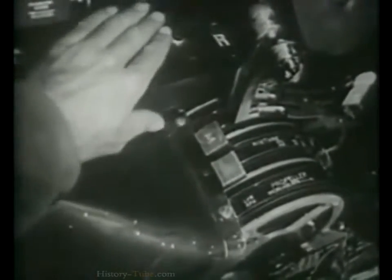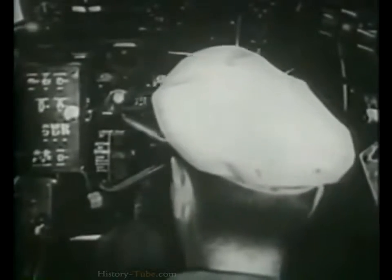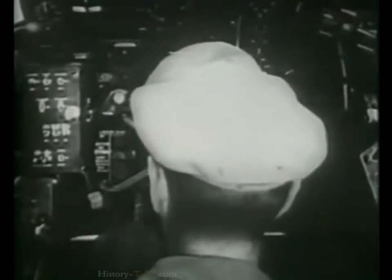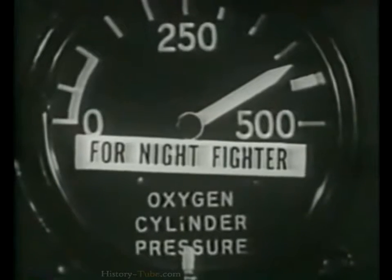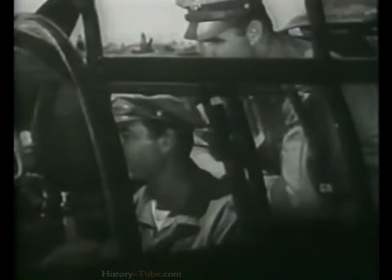See that all controls and switches are set properly. Open throttles one-fourth to one-third. Prop control switches in automatic. Feathering switches normal — test the prop circuit breakers to make sure the buttons are in. Check fuel in all tanks. Fuel valves set to outboard tanks. Cross-feed, which supplies both engines from one tank, off. Air pressure for emergency brakes ought to be 425 to 450 PSI. Check the clock against your watch and the altimeter. Oxygen pressure 425 PSI. Oxygen regulator to auto-mix on. Test the trim tabs; if they're in good working order, set them for takeoff.